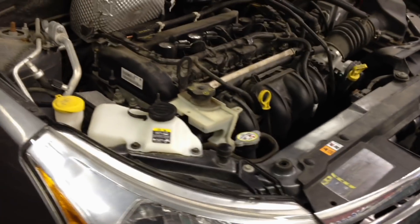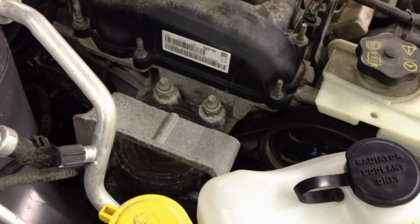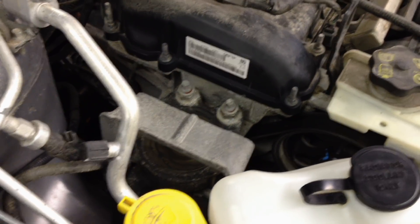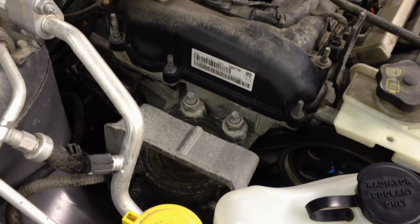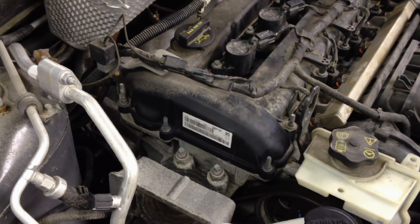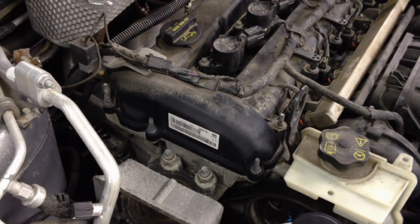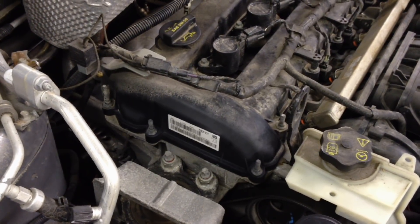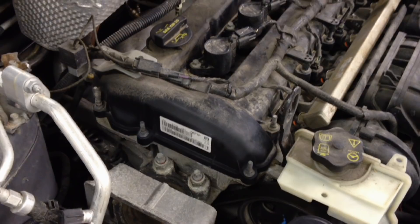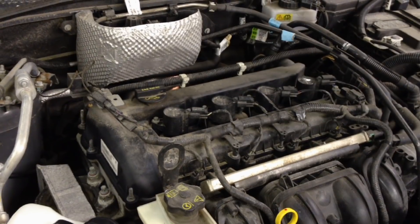In order to test if your mount is bad, it'd be hard to visually see it. That rubber separates in there, rubs away, and then the metal grounds out. You start feeling more and more vibration at idle in park, but especially while you drive — you'll feel like the engine is running rough, but it's just regular engine vibrations transferring through to the body.